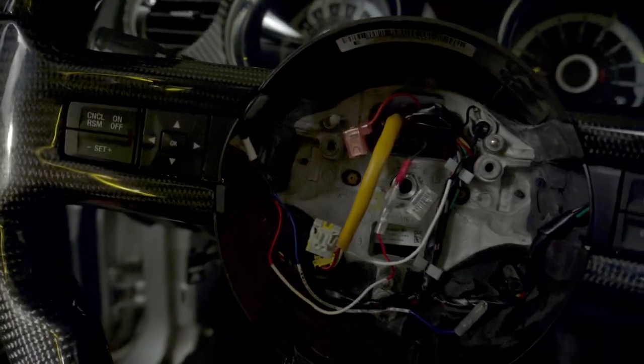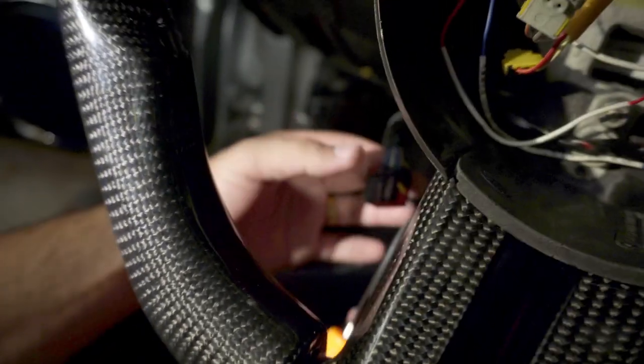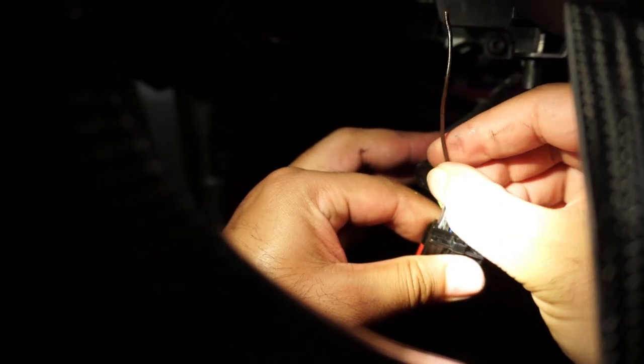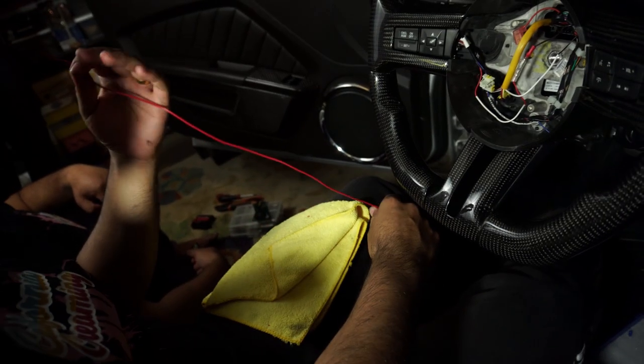Now move down to the bottom section — same situation. Pull the red pin back, push the new pin in, and you'll just have to run the wire from there to get power to the steering wheel. To put the pin connector inside the empty slot, just put your nail here and pull it carefully back about a quarter inch. Get a good connection. After you get the pin connected into that connector, plug it in. I cut the wire about three to four feet.